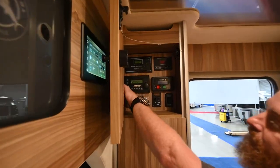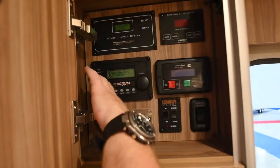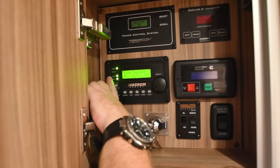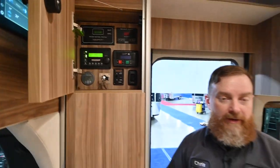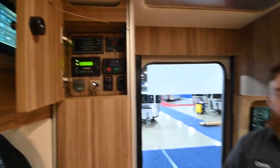Above that we have your inverter. There's only one button on here you ever really need to push — the one in the bottom left to turn the inverter itself off and on. The inverter is going to provide an AC service when you're boondocking and you don't want to run the generator or can't plug into shore power. All you're really going to get out of this inverter is power for the television and the plug where a DVD player could be mounted. It is just a 1000-watt inverter on this van. When plugged into shore service or when the generator is running, those items already provide AC service and you will not need the inverter on in those situations.